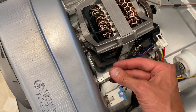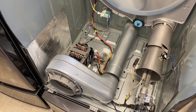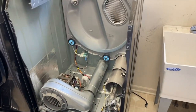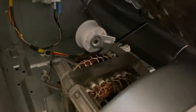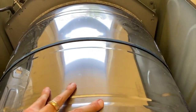Re-secure the electrical connection and verify everything is secured, then we'll reverse the steps. Grab the drum with the belt on, lift it up, reinsert it, and rest it on those rollers. With the drum back in place, let me show you what the belt is supposed to look like with the idler pulley — it loops around the lower pulley on the motor as well. Take pictures and make sure you know exactly how this belt goes back on.